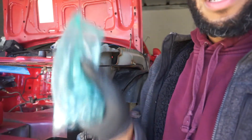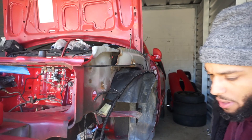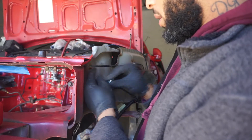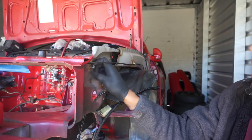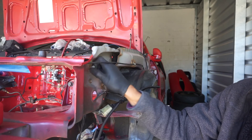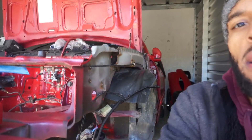I got my little bag of 10 mil bolts - M6 by 1.0 - I bought a bunch of bolts off Amazon. I just want to make sure this will thread in. Yep, see that threads in perfect, and I know it's tapped out so that's perfect. It also threads in way easier - you can see I can push that all the way in with my hand and tighten it down by hand. That's all the way in. It just cleans up the threads a lot, so using the tap tool is definitely a good investment.